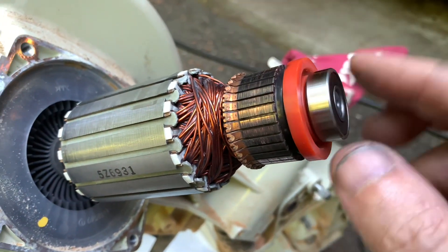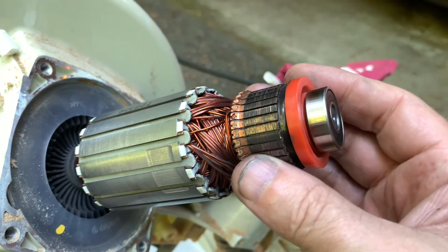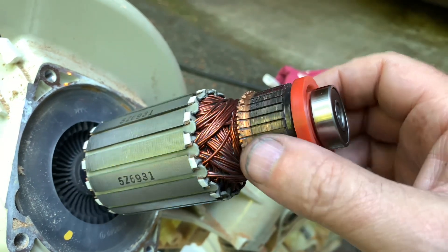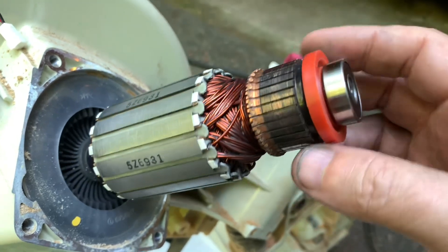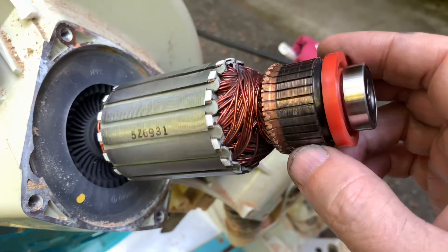This bearing feels great. I went online to buy a new commutator thinking it was like 50 bucks, but you have to buy the whole armature assembly. They're maybe discontinued — there are people that allegedly have them wanting $160 to $220 for them. So I figure the next step is I'm going to try sanding these plates of this commutator and making it smooth.